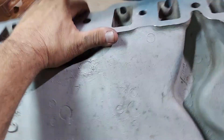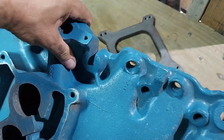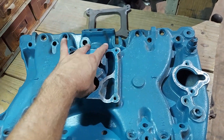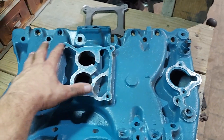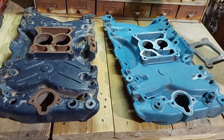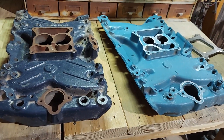These manifolds also do not have any kind of exhaust heat riser, so it would probably take longer to warm up with a carburetor. If you put a carburetor on here, it would basically just dump fuel right here, and since you have very little velocity, the fuel would just kind of puddle up — you'd have a pretty unstable idle. It would probably be pretty difficult to get these engines to idle well at low RPM, so it would be better to just switch to a regular dual-plane manifold for street use with a carburetor.